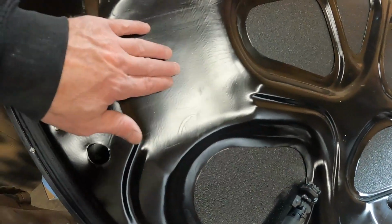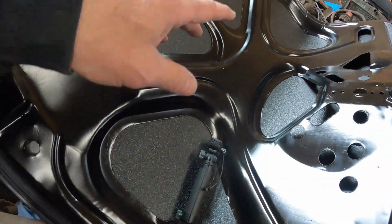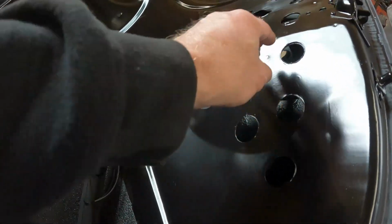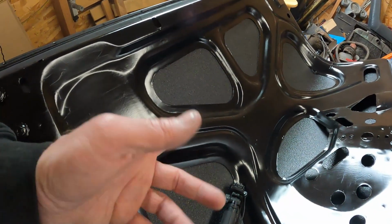I'll wax and grease remove it in case there is any residue. I want to get all the residue off. Then I'll scuff this, and I'll just have to mask off the inside parts now, which these will be easy. This will be kind of a bugger. Just throw some paper in here maybe. Anyways, we'll get this taken care of, and I think we'll spray one whole coat on this thing too. Since I screwed it up the first time, might as well try to make it look a little nicer, right?